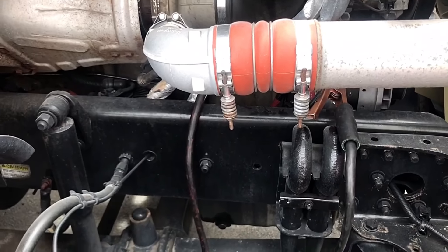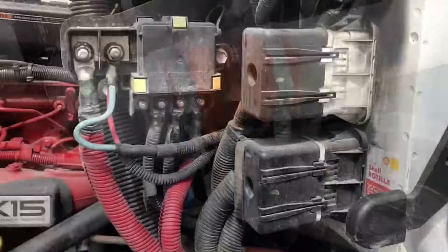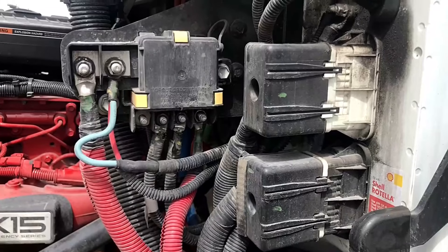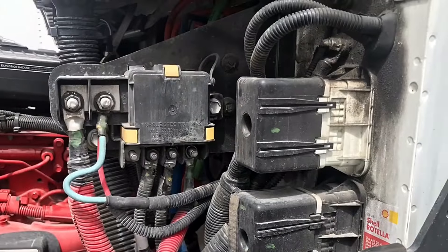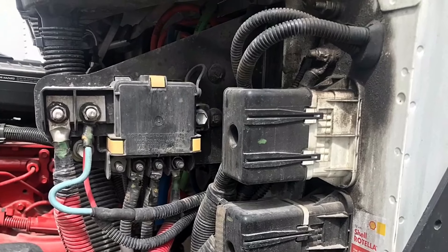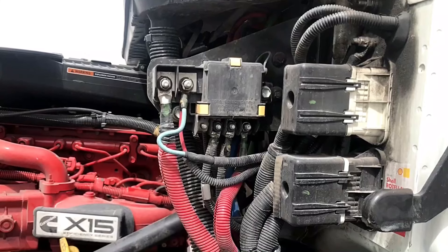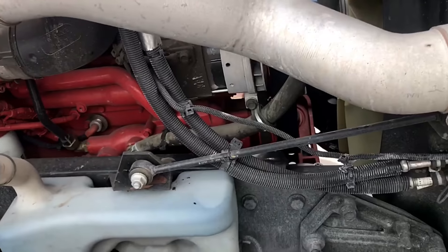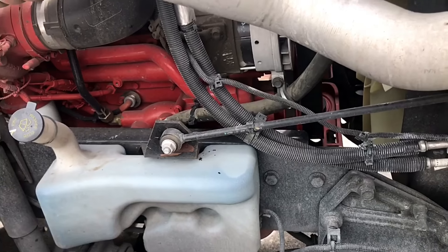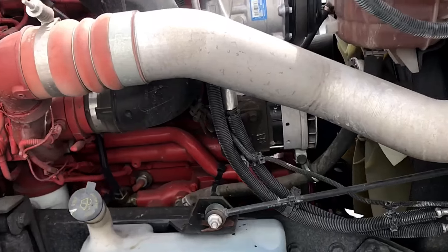These tricks work on multiple trucks — just be careful when you do it. On international trucks, in certain circumstances, I've hooked my cables to the power lead where the red battery cable runs right to the battery. Where the arrow points out the negative part, put your negative cable there or on the frame. Be aware of the fans and use your meter to confirm there's power.